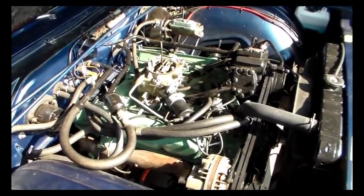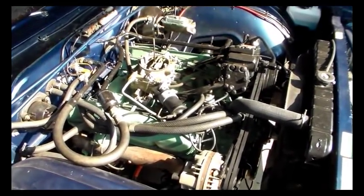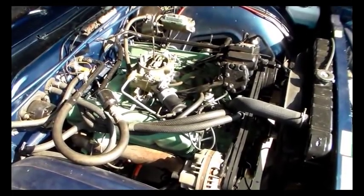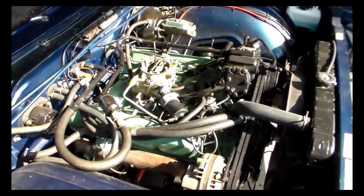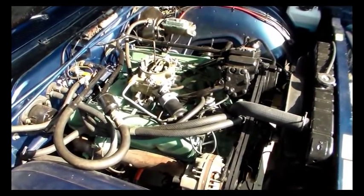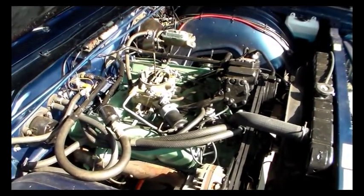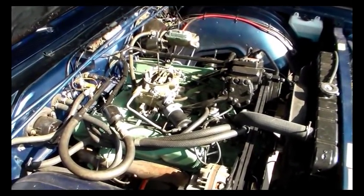as I remember, I checked the float levels on them, but that doesn't mean anything. I could have done it wrong. So I hear a train coming. So anyway, we need to get that carburetor off there, and I've gotten some new needles and seats to put on it and a new insulator to put down there. So first things first, let's take that carburetor off.